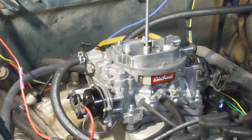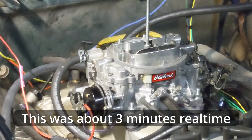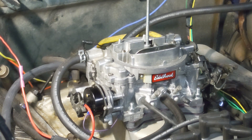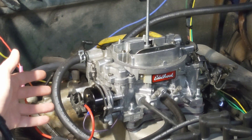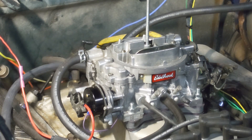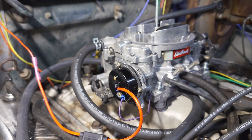We've got the choke hooked up. I've got my coil undone and I'm going to turn the key on and see how long it takes for the choke to open up. After a few minutes, that choke is just about all the way opened up — keep in mind this is a completely cold engine, so I'd say that's a good test. I can adjust it back and forth if I want it to open sooner or later. When I unhook the power, it'll slowly close as that metal spring and the whole motor cool down. Pretty easy on an Edelbrock carburetor to replace your choke thermostat. Hope you enjoyed, and we'll see you next time.